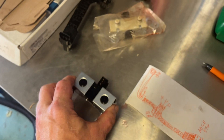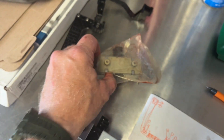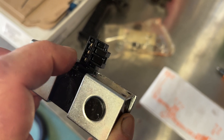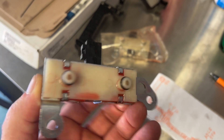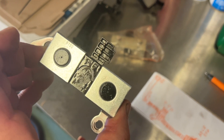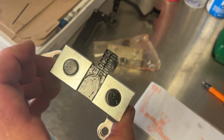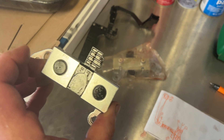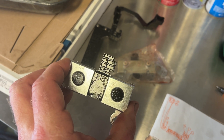This is the good one, and this is the one I just took out — you can see the pins there. I was supposed to get 26 ohms from common to each of the solenoid connections. The old one indicated good. But I got no ohms going from common to the A setting, the middle pin. So that told me that out of the box, this brand-new solenoid failed. That's what was causing my P0750 code and my overdrive light to flash on the column.